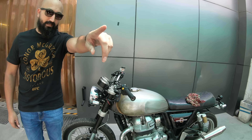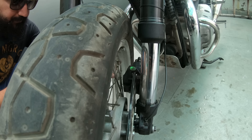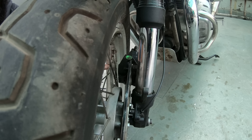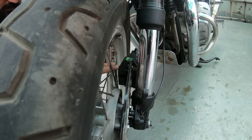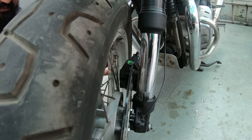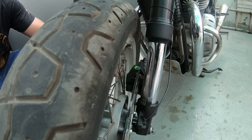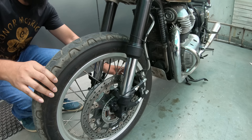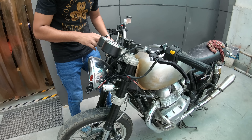If we can bring the camera up close, there is not a lot of space between the spokes and the caliper. In order to make that fit — because this is a four-piston caliper, not a two-piston that comes on the stock motorcycle — with the pistons being on the inside as well, we had to move the disc away from the hub. We also had to create spacers so that the wheel sits in the middle. Right now we've put in a heavier fork oil.